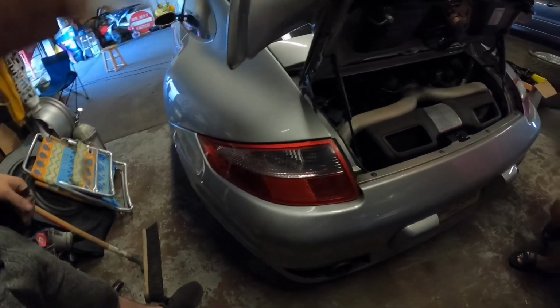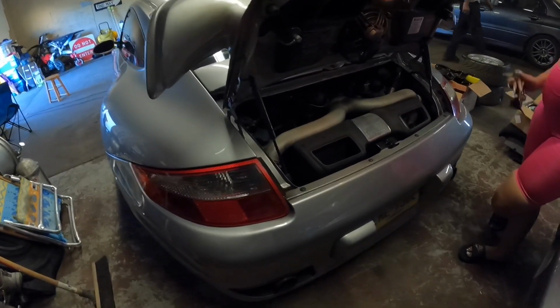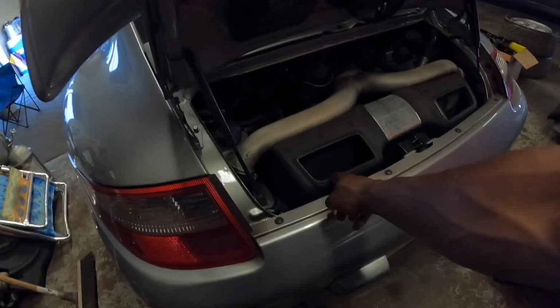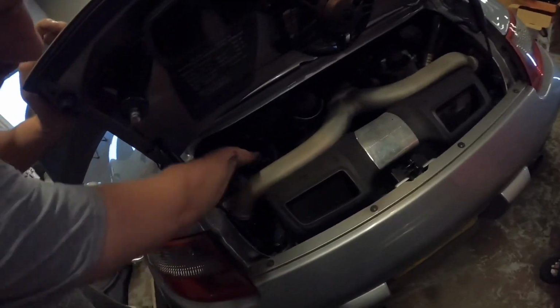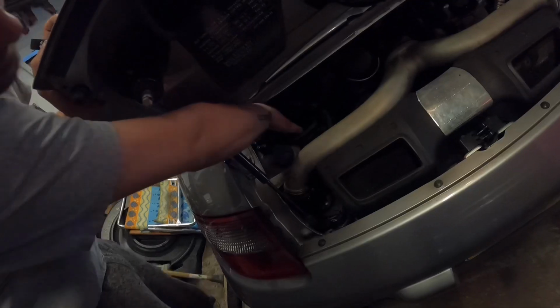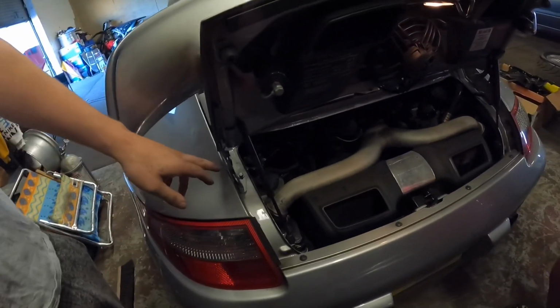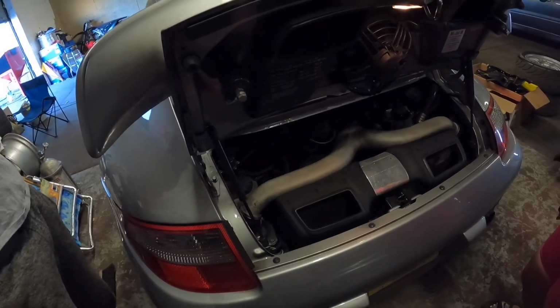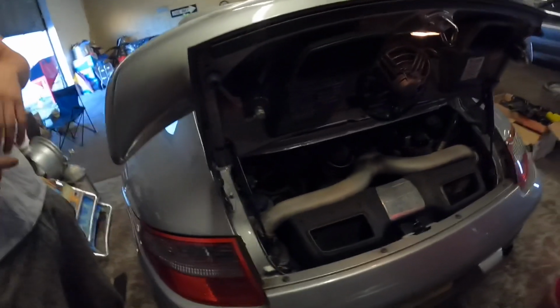For stock turbos, we stay with the stock airbox for as long as possible, even with the VTG hybrid upgrade. This is the airbox? Yeah. Wow. Everybody always thinks we did intakes. They're these silicone boots right here, and they run all the way down to the turbos, which are under the car. They'll work for the VTG hybrids, which would be the upgrade for a stock location turbo. Once you go bigger than that, you basically can't do it.